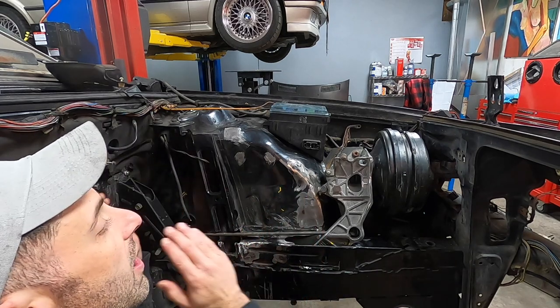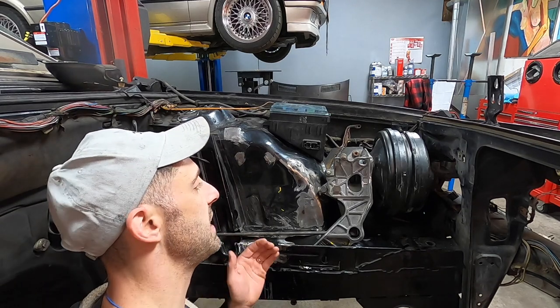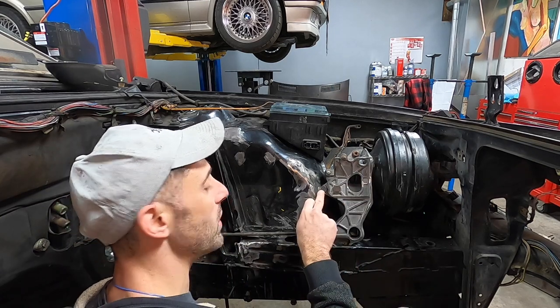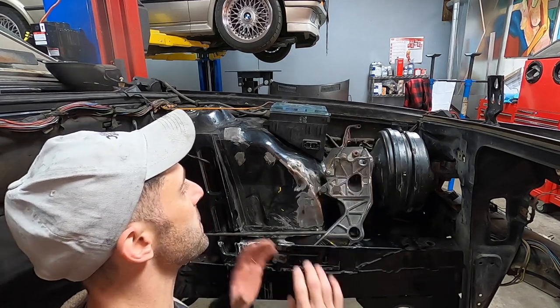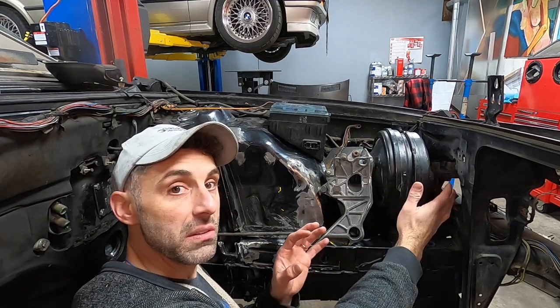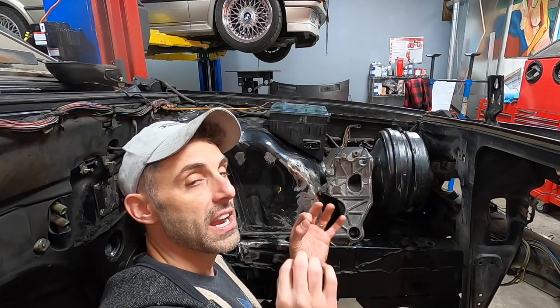This is bolted onto the firewall. The brake pedal is moved over approximately one and a half inches. This is mounted in three locations: two bolts here, one 17-millimeter M12 here, and then two M10s up above that's also welded to the wheel well structure. Now let's talk a little bit about the brake master cylinder and the reservoir in terms of where that's gonna be located in a remote fashion.